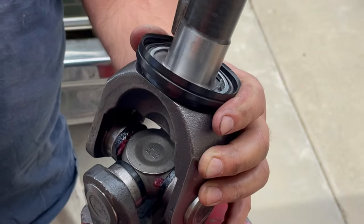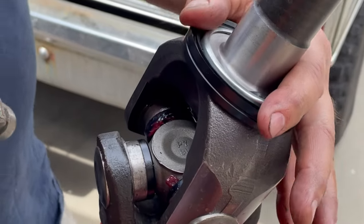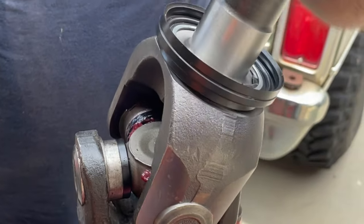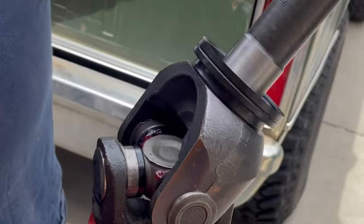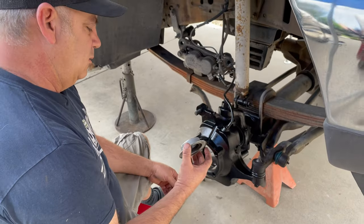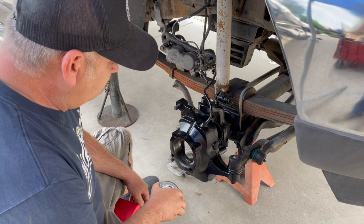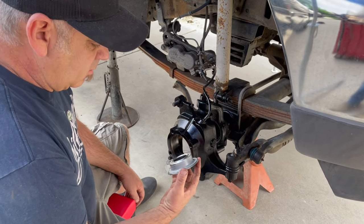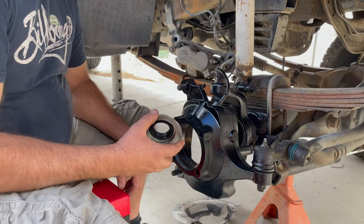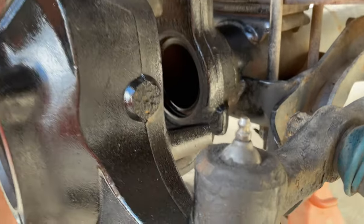This is just tapped on, and then this surface will seal against the backside of the spindle. See how it's got flex to it — it's able to ride against the spindle and keep all the dust and dirt out. So we're getting ready to get the axle and put it into the housing. I'm going to reuse this little seal — it's going to go right in the end of the axle tube and just keeps everything from going into the axle.